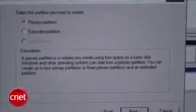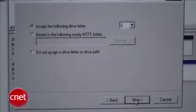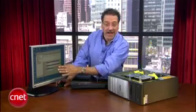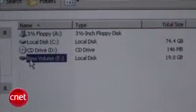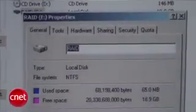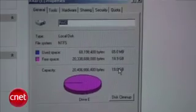This is where you'll partition and format your two new RAID drives and make them usable to Windows. Right-click and do a new partition — set a primary partition, use all your disk space, let it assign whatever drive letter it wants, format it, and let her rip. Our partitioning and formatting went fine. It shows the amount of space we have — I used small drives in this case — and it says it's healthy. Now let's head over to My Computer, where we look for the real proof: does our drive array show up as a drive? Sure enough, there it is. It's called New Volume — let's give it a name. I'll call it RAID. And if you look at the properties: two drives showing up as one, there's your free space, and they are mirroring each other as a single drive. It's like magic, folks.